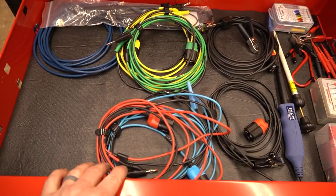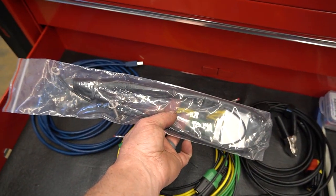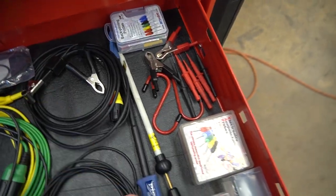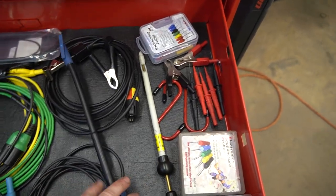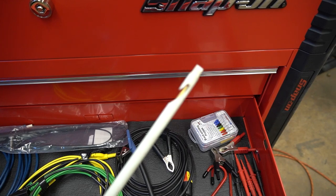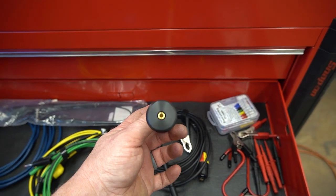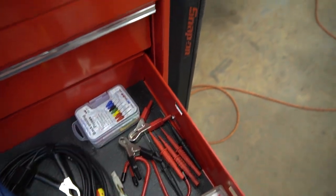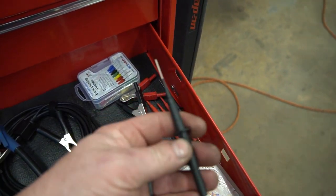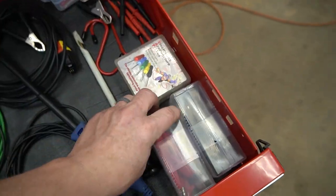Next drawer down has all my scope voltage leads that'll eventually go up on a boom. There's an extender for coil-on plugs so you can use the secondary waveform pickup probe on it, a wand secondary pickup, and a Phil's piercing probe — instead of just one pin, there's a whole bunch of little needles that pierce the wire so you can get a good signal, and then you put your scope leads in the back. There are also needles for back probing, a bunch of clips, and various other probing bits and alligators.